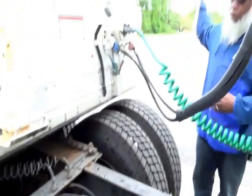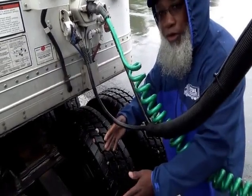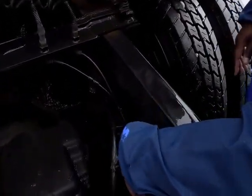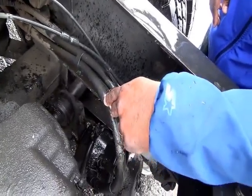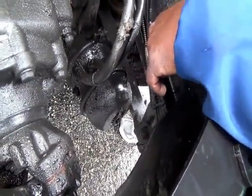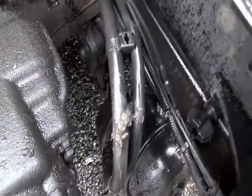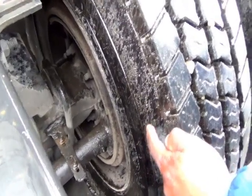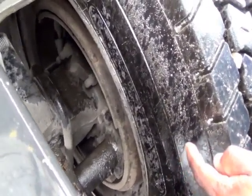Go to your two systems on the front axle — braking and suspension. Start with the ABS line and brake hoses — not cracked, not broken, and secure, not dry-rotted, no leaks — going to the brake chamber, not cracked, not broken, and secure, not dented, no leaks. The pushrod is behind the brake chamber — you have the pushrod, slack adjuster, and adjusting nut. Inside the wheel is your brake drum — not cracked, not broken, and secure, not dented. Inside the brake drum are your brakes aligned with the brake shoe liner — not cracked, not broken, and secure, not worn dangerously thin.